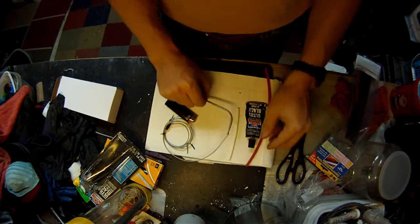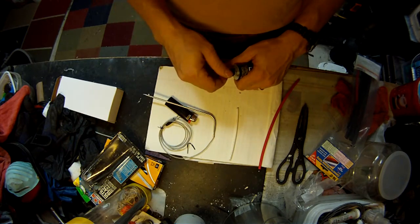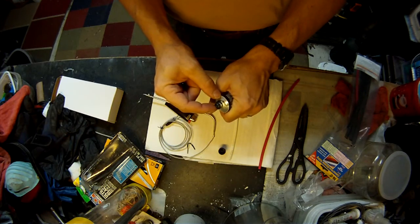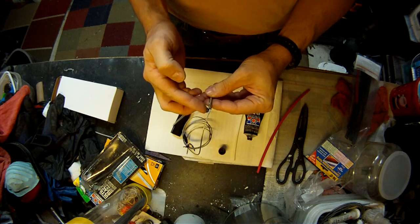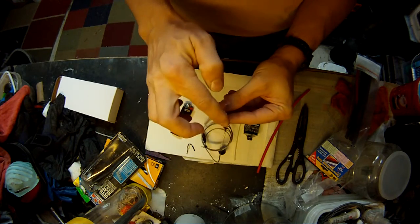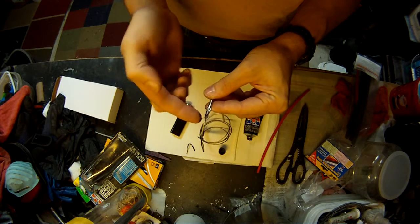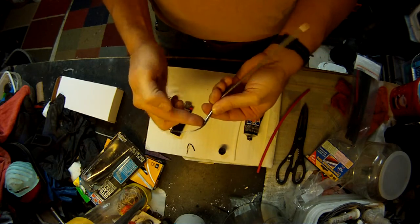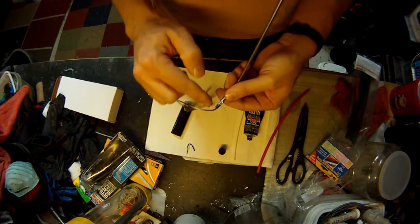It's real easy. First thing we're going to do is pack a little of that RTV in there. I've tried to do it a million zillion different ways, but none of them work quite as well as a little dab on the end of your finger. And you don't need much, maybe half a pea. Okay, because what you're going to want to do is be very careful. You only want to get this right at the joint here and not any further up there than you have to. Now what I usually do is try to just kind of keep packing it up and working it down into that pipe a little bit. You just want it right there near the joint. Doesn't need a ton of it, but you got to make sure it goes down to the crimp. Try to kind of pack it in there down to the crimp.